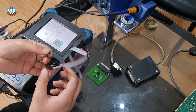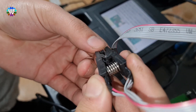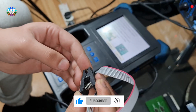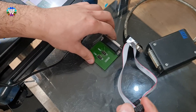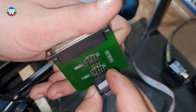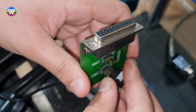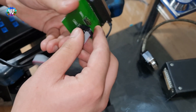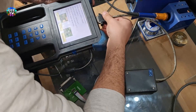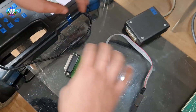Now use the clip matching pin 1 of the chip — the red cable side is pin 1 of the clip. Then connect the other side of the connector to the board of the Dash Fixer. Please use the board shown on screen and be careful to match the pin 1 side on the board and cable connector as shown. Connect the M-Plex to the Dash Fixer machine and then the board to the M-Plex.